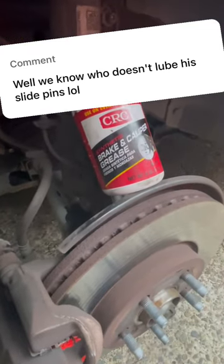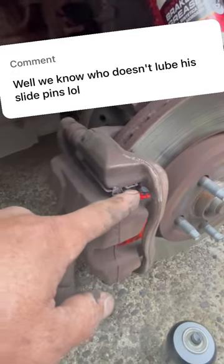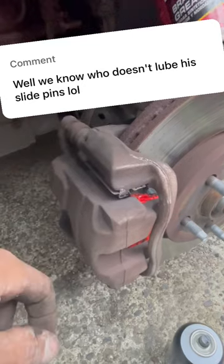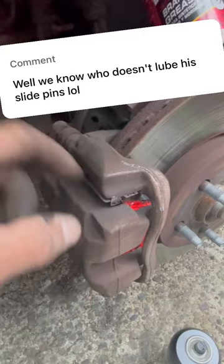This is one of the reasons I use disc brake caliper grease on my pins and my sliding mechanisms where my pads are in my contact points. The last thing I do before I bolt the tire on is I check to see if everything slides and if everything is nice and free with no bind.